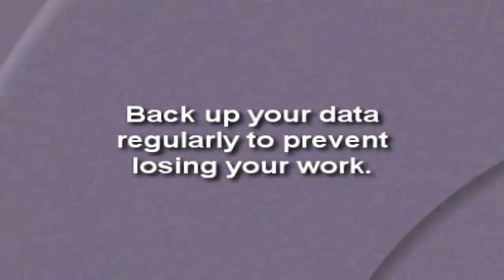There's something else you need to do: you need to back up the data on your PCs regularly. Remember that a PC is really a mechanical component — your hard disk drive has an electric motor and spins platters. Mechanical components wear out over time. It's not a matter of if that hard drive is ever going to fail; it's a matter of when. It may be a long time from now, but it will fail at some point. You need to make sure that data is recoverable by backing up important data off the hard drive on a regular basis.